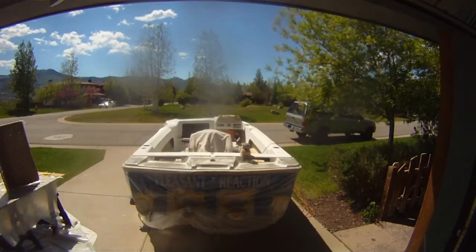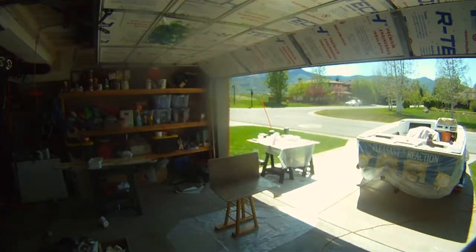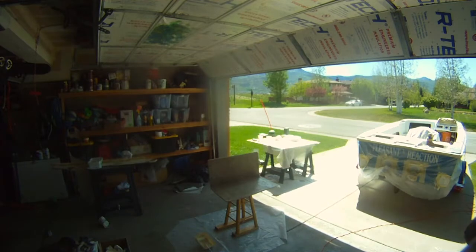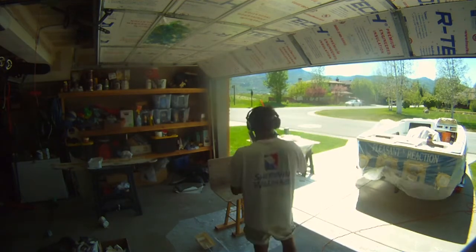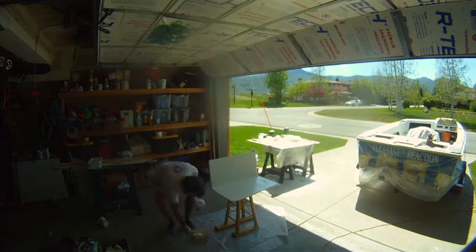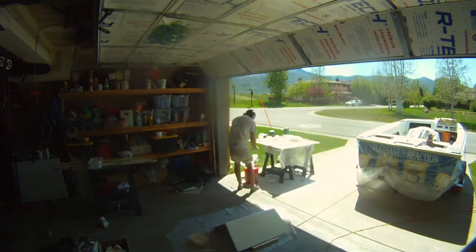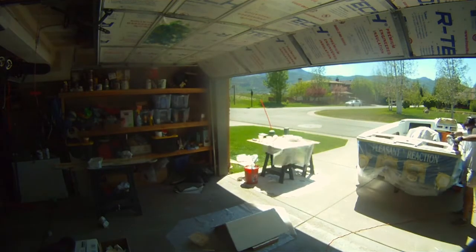This time I just do a short session of sanding because that resin and that fiberglass just sets up so hard in the sun that it dries almost immediately, and so I do my little setup here in the garage so I can gel coat in the shade. I'm going to gel coat this thing, and once I've gel coated it, then I can let it sit for a long time and not worry about it, and I can do all the sanding and the trimming of the excess fiberglass that I need to get this thing cleaned up